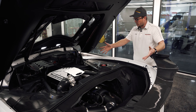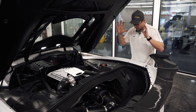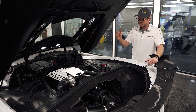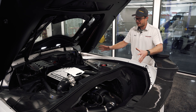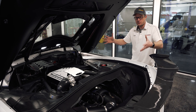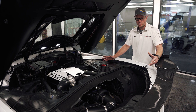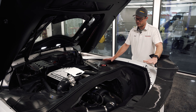As far as other mods go on our car, we're actually still on stock headers and stock cats, so we've only got the base ProCharger kit on here with the P1X head unit upgrade, which is what we recommend, as well as the Stage 2 pulley which brings the boost pressure up to 7.5 PSI. We like this setup because it gives you exactly the amount of power that we have the fuel system to support without making any fuel system changes. We're using 93 octane here, so those are the power numbers we're going to show you, but we can also support 91 octane and tune for that if that's what you have.